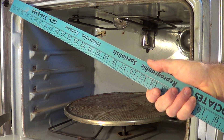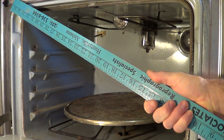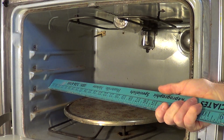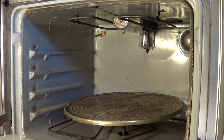The nameplate on here says this is an 18.1 kilowatt oven, which is a lot for a range, but this is a double oven. If you figure the bottom oven is 3,000 watts for a regular oven, the top oven is 3,000 — that's six — and the cooktop with four burners is around 8. That's 14,000, with an extra 4,000 left over for the microwave.